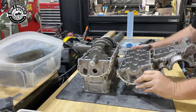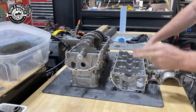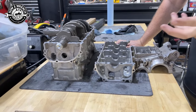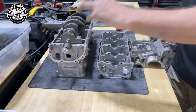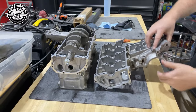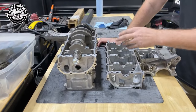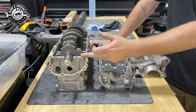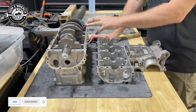I'm going to simply flip that in this direction. What that's going to do is let me keep one-to-one, two-to-two, and so on. The other thing I'm doing — just because I think it's a really good habit — is I have the engine set on the bench. This is the part that's upside down; this would be the nominal part. Here's your transmission, here's where your counter shaft sprocket would be. I like to set things out in an orientation as they are on the motorcycle. So this would be the left side, which would be one, two, three, four for cylinders, and one, two, three, four, five for the mains.